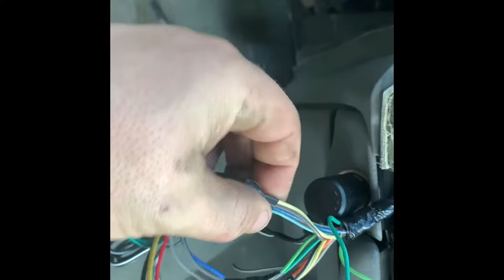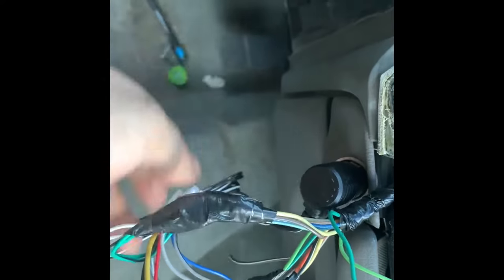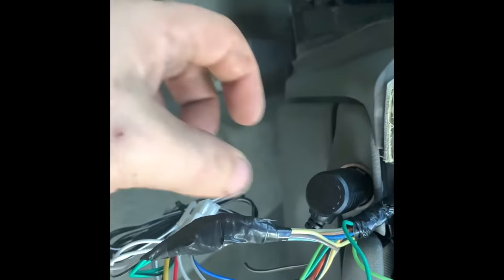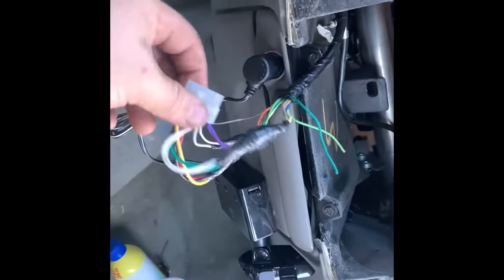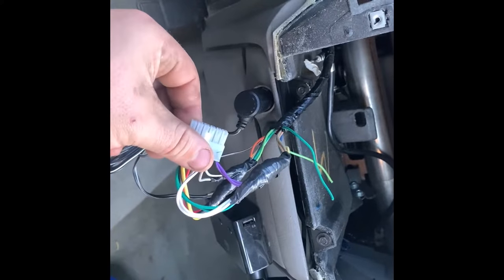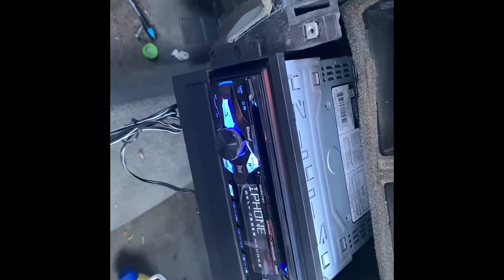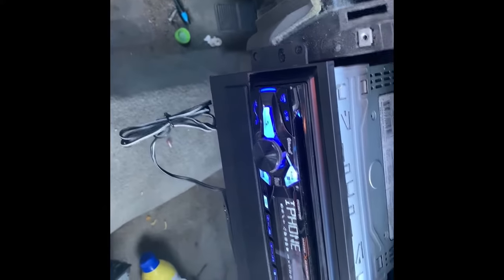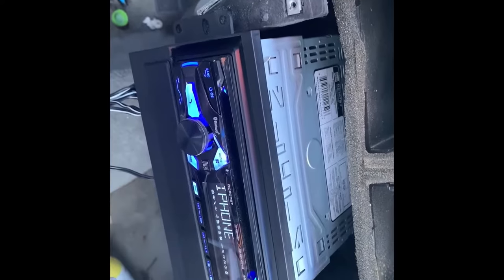The biggest thing is to take your time, make sure your wires are twisted together properly, and tape them very strongly — vibration can loosen things. Put a couple layers over each connection because if a wire pokes through you can short something out. I've never had it happen, but just to be safe. I'm going to plug this in and see if it works. The radio is on Bluetooth and it works — the FM and AM aren't working, which I think is an antenna problem.